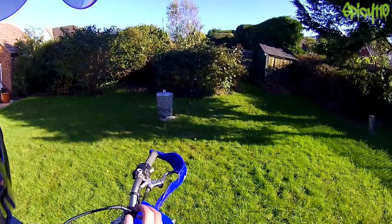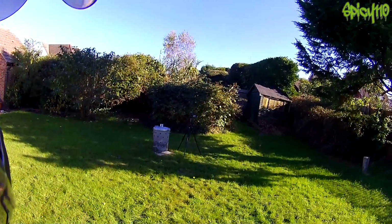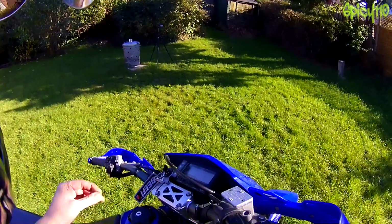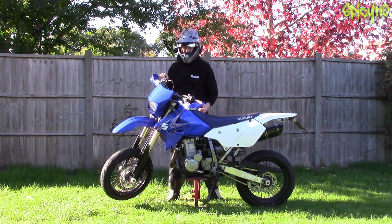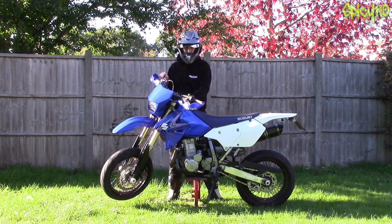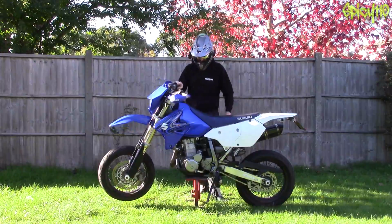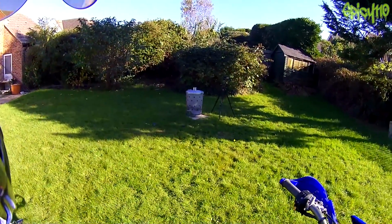They're getting old. So continuing to move down, if your bike has a fuel filter, that's something that will need to be changed periodically, because it's saving the little bits of stuff going into your engine, but eventually that will get clogged up and that will stop the fuel getting into your engine anyway. So it's normally in line, take it out, put a fresh one in, if your bike has a fuel filter in line somewhere.